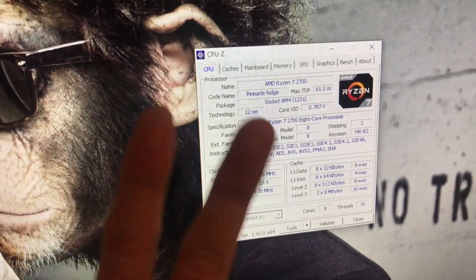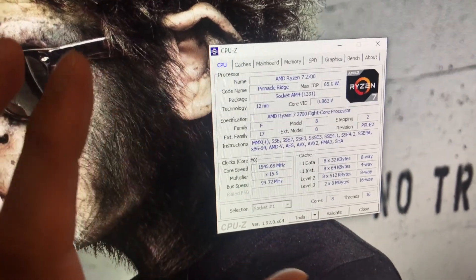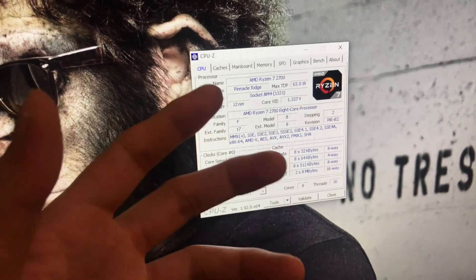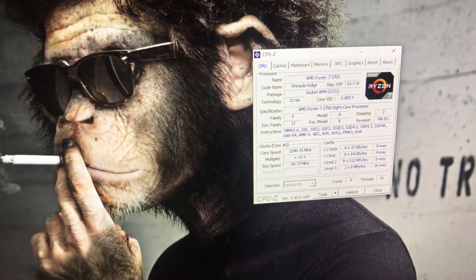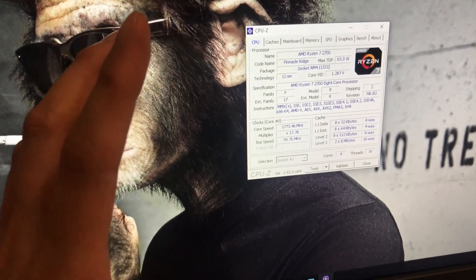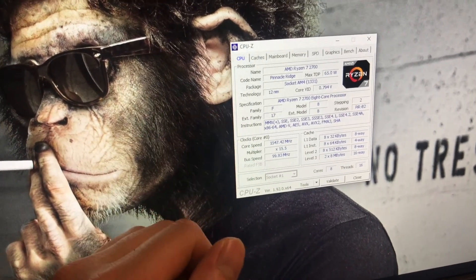After you install the CPU and reset the CMOS, that's what allows your system to get the new CPU set up completely. You may be confused or worried about some steps, but I've shown you the instructions when you first boot the computer. You must say yes to reset all passwords or PINs. Remember that, and good luck with your upgrade.